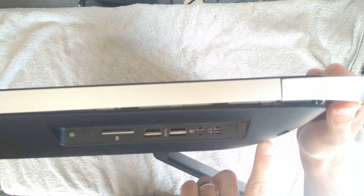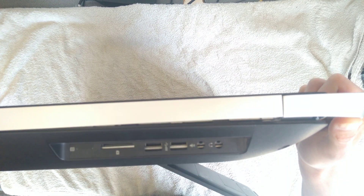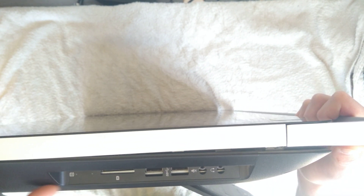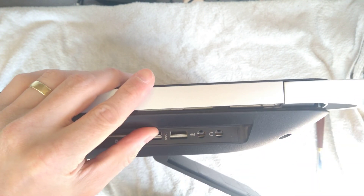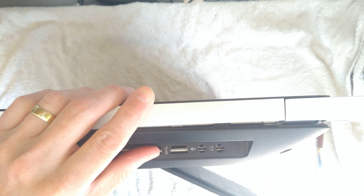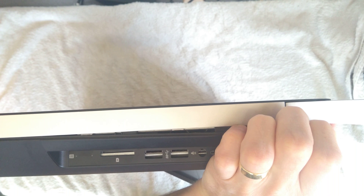You can see where I've undone the screw here — it's started to push the casing away from the rest of the body of the machine. And if I hadn't undone the USB here, these are no longer aligned, so if it was still plugged in it would have been holding the case or at least bending the USB away from the motherboard — definitely not something you want to do. Let's double check that the other side is as unclipped as I can get it.